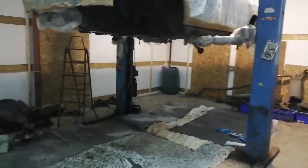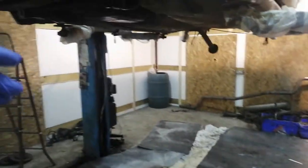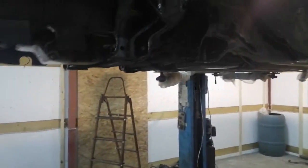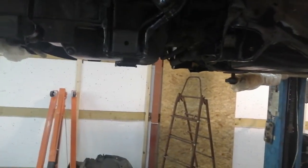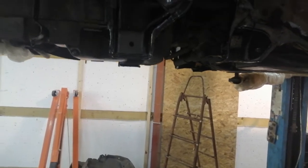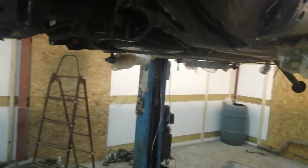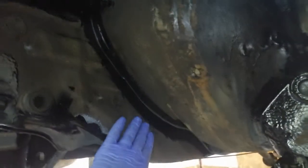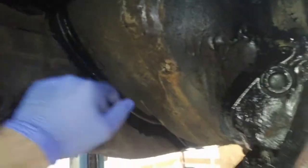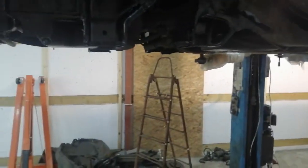Okay guys, so Tuesday now, so it's my first day kind of back. The seam sealing was all done, and what I did then was I went around and did what Rustbuster, who make the epoxy mastic, recommended, which was to do some striping. Basically this is a process that they use for ships, where you're going around and getting the tight nooks and crannies with the brush.